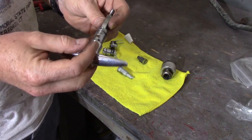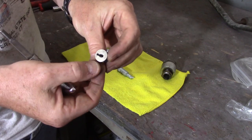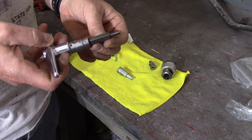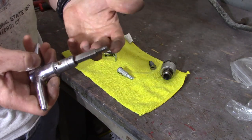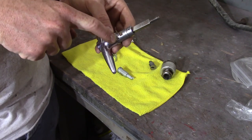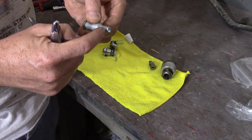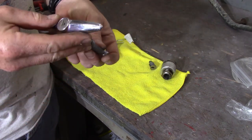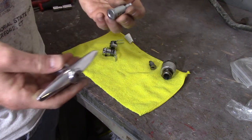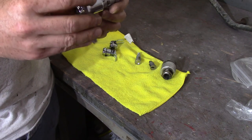So this is the boot lid handle — this one goes together a little bit differently. You can see that number stamped in there: that's 904. If you look at the old ignition tumbler, that's 942. Those are key numbers, I believe — so if you ever had to get a new set of keys for the car, you could know the number and call Triumph back in the day. The way that this appears to be done is there's a little dowel in here, so I'm going to have to drive that dowel through. That dowel will fit into this little groove and lock it in. I need to pay attention to the way this comes out since it's probably only going to go in one way. I'll just take a little punch and the hammer and hopefully that's the way it's going to work.